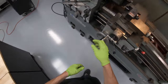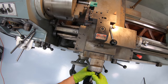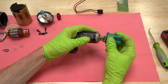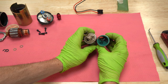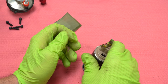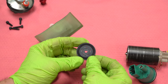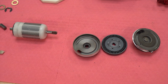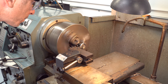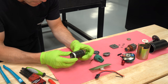These reactive turbine pumps tend to be a little more efficient and quieter, and are typically the submersed pump found in most street cars. To get this pump all the way apart, I have to cut both ends off. This is the inlet side and the electrical side — you can see a couple of wires connecting the plug with the motor, and then the pump section, which is very different. It doesn't have that roller vane — this is called a reactive turbine pump. These types of pumps should never be run dry on fuel; they can be damaged in less than 60 seconds. I'm cutting a little farther back to try to release the motor from inside the can — these things are not meant to be taken apart, but it's worth the effort to see what's inside.